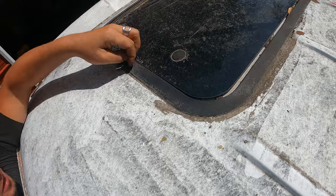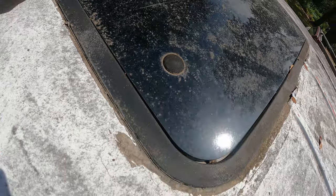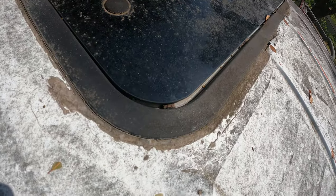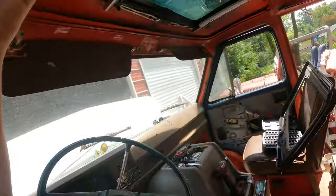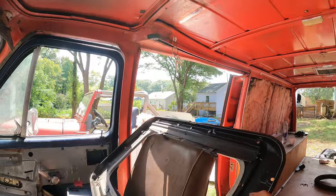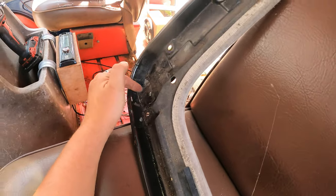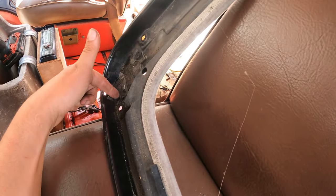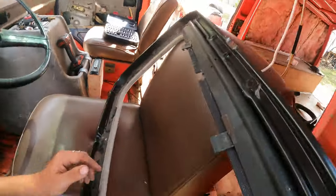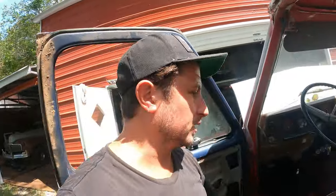The flange overhangs the hole and you glue that in. You can see the sunroof has this whole ridge around it — that's where the leaks usually come from, at least most of them. And that gets caught by the pan that comes in from the bottom. On our pan, this whole contraption over here is leaking, so we're going to clean this all out and reseal it so that when the water runs down, it collects in here, runs out the little tube, and we can feed it out through a fender well.